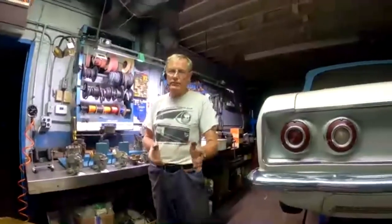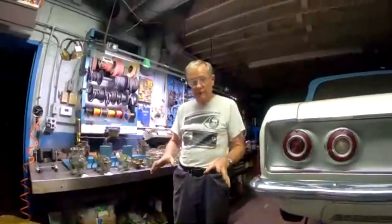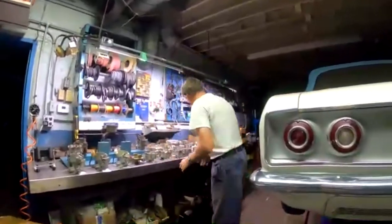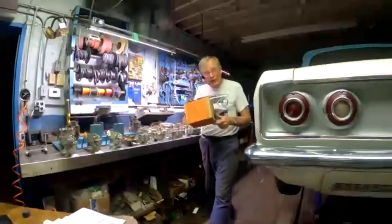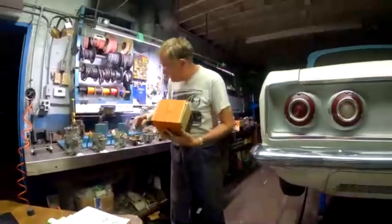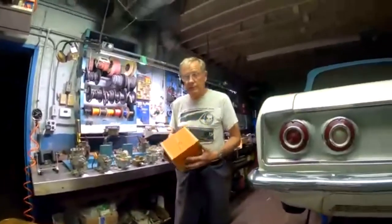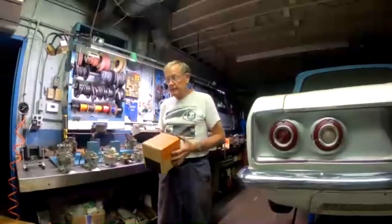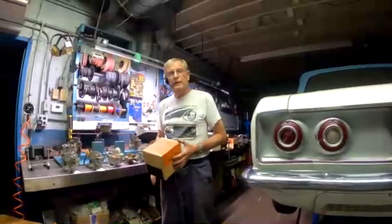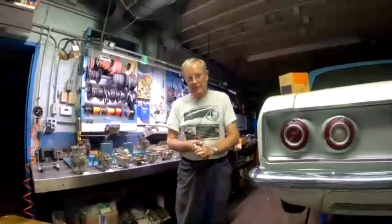And avoid, if you find a so-called rebuilt carburetor on a swap meet table that is not a brand new Delco Rochester like this one is. This is actually a brand NOS carburetor. That one would be fine. But if it's from some other company that does a rebuilding, just take a pass. It's a good, clean core. That's what you got when you buy one of those.